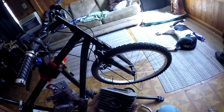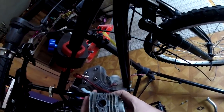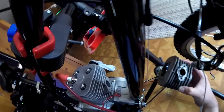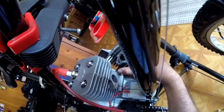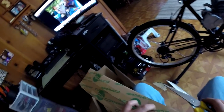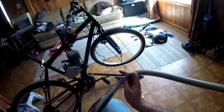Now for the cylinder exhaust port, the YD100 is indeed larger diameter than a standard PK80 China doll. It's probably hard to tell on the camera, but I matched the gaskets up to them and I could tell that the YD100 had a larger port. It wasn't significant, a few millimeters maybe.